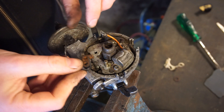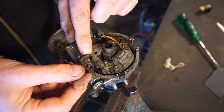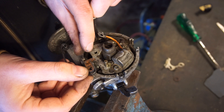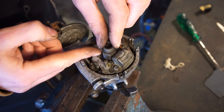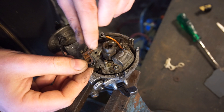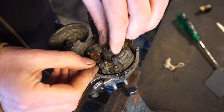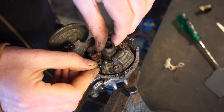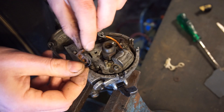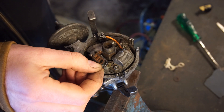There's one more thing about routine maintenance with a points ignition system - this part wears. And due to that wear, that's why the point gap closes up. To prevent that wear, you're supposed to lubricate this part of the distributor on here - just a tiny, tiny bit, usually with some dielectric grease. But check your manual on what your specific vehicle needs. And that will help prevent premature wear, because if this runs completely dry, this will get hot and just melt away, and your points will close up in no time at all.